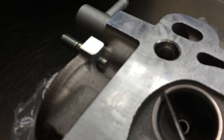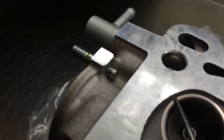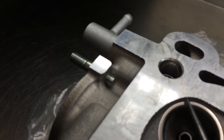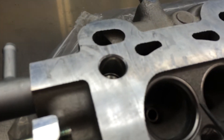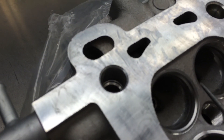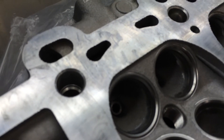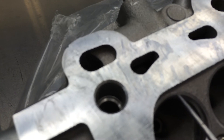The sidewall goes all the way up along there. The larger the diameter of the cut, the more this wall walks up — it will actually sometimes intersect into the combustion chamber surface or the deck surface up in here. The wall, as it goes all the way around the cut, you can see it has just a small tiny lip where it meets the casting all the way around.